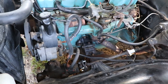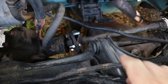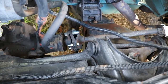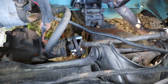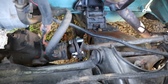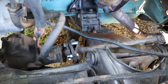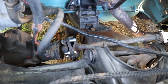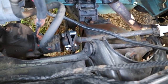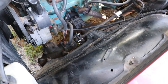Before I forget, there's a new piece of equipment on this car — see this right here? You know why that gets replaced? Because it goes out. Thank goodness I had just parked at work and turned the wheel with the ignition off to straighten the wheels out when that thing completely shredded in half. So I was lucky I was sitting there at work when it happened. That's new, that's safe, and it actually steers better. Sitting out there in the Arizona heat just dry rotted that old rag joint. If you go to buy one to replace it, it's in the help section at AutoZone — but if you call it a rag joint they have no idea what you're talking about. It is a steering coupler joint.